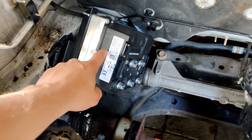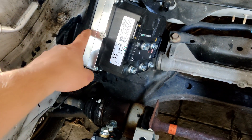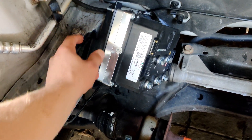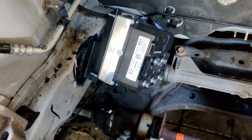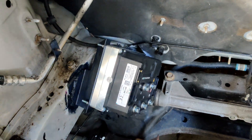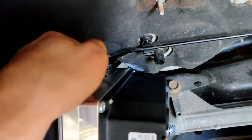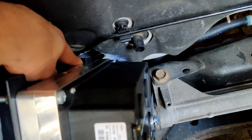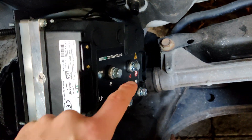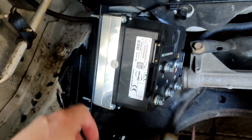Right here I have the inverter for the Hyper9 motor, which is right here. I mounted this directly to the chassis by welding on a piece of steel channel that I cut to size, and I welded that directly to the chassis frame in two places — there's one piece here, and further back there's a piece right there. I also drilled four bolt holes in it to correspond with the four holes that hold the inverter and the chill plate in place.